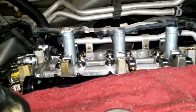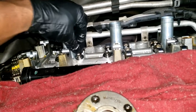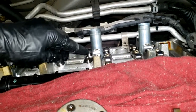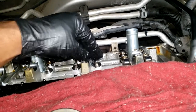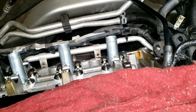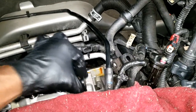But typically you do not have to replace the lifters, lash adjusters, whichever you want to call them. None of these have collapsed. They are holding firm, holding steady. I guess they pumped up with the oil pressure. I will, however, check them. Physically check them. You can visually check everything, but visual only goes so far. You need to lay your hands on this stuff.